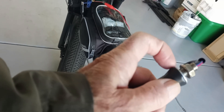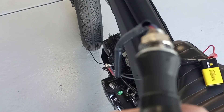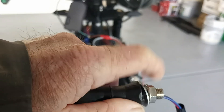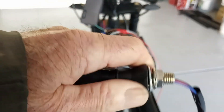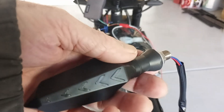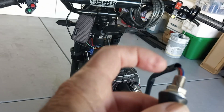A couple of other things about these lights — they don't come with a washer, and I recommend putting a washer on them. The nut is serrated, so it's kind of like a grabber nut. When you tighten these down, don't over-tighten it. As you're tightening it, you'll feel it snug up — get it good and snug but don't over-tighten, because if you do, you'll pull this little nipple right out of the light. It's just epoxied in with a little rubber mount. If you keep tightening and it doesn't feel tight, you'll pull it out and your lights are ruined. I've seen a couple of guys on YouTube over-tighten and pull it right out.